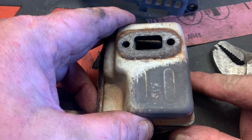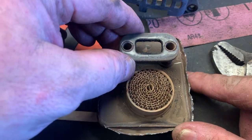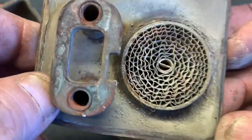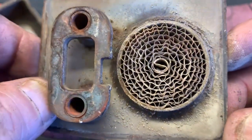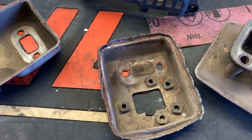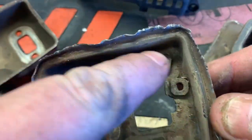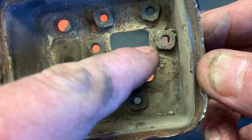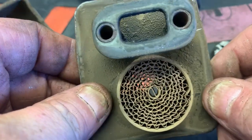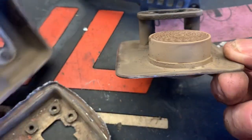Very interesting — let's go ahead, I'll remove the cover and we can see the catalytic converter assembly. This one's clear; however, it was stopped up in the diffuser as I showed you earlier, and the whole muffler is just rusted out. These plow nuts are stripped out and it's rusted in places. The exhaust comes in here from the engine, and there are really no baffles at all — none whatsoever.